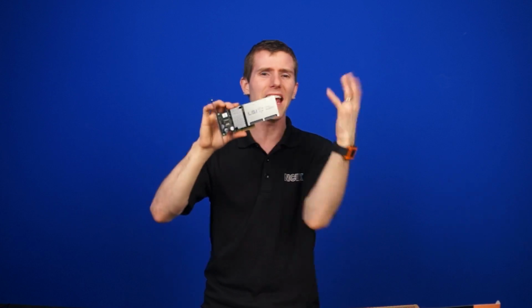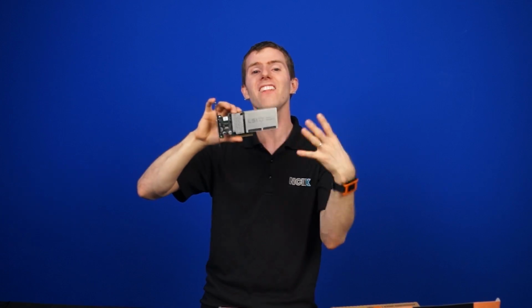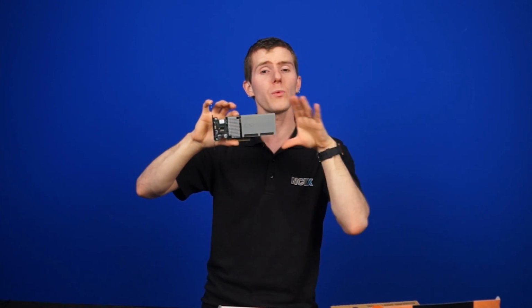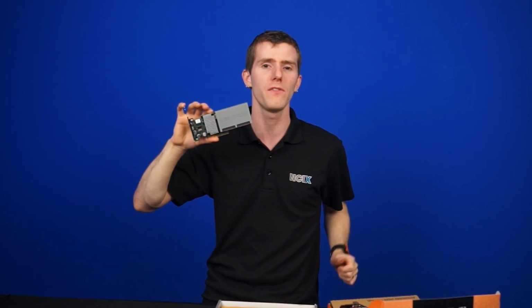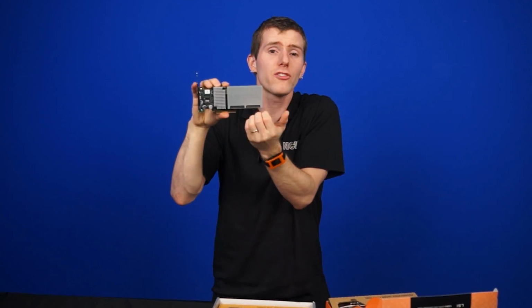So what is this flash used for? Essentially, it's like having an SSHD-style RAID, they call it their elastic cache algorithm, that delivers intelligent acceleration for your data. The frequently accessed files are stored right here on the flash memory. LSI calls it automatic hotspot data caching. And actually, LSI wants you to dedicate as much of the flash as you want to pure storage caching, just in case you want some files always available as quickly as possible. They give you that option.